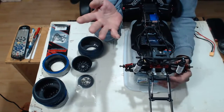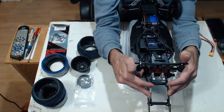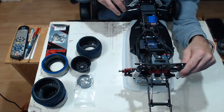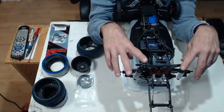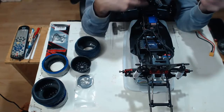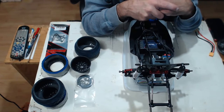What I still have coming: I've got red adjustable links coming for easier and faster adjustment of the wheelie bar height. Different shocks that I have to go all the way through and turn into well-functioning shocks — 100 millimeters for the rear, 90 millimeters for the fronts — they'll get limiters and shock oil adjustments and everything else. From there, Fast Eddie's ceramic bearings throughout the entire build — wheel bearing carriers, the transmission, bell crank, wherever there's a bearing — it's a Fast Eddie's ceramic bearing. That should really lessen resistance and make this thing quite a bit faster.